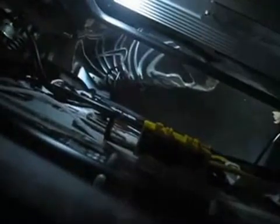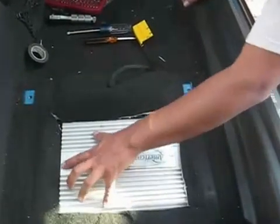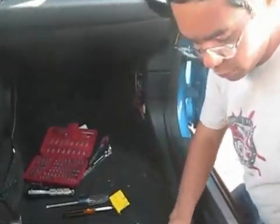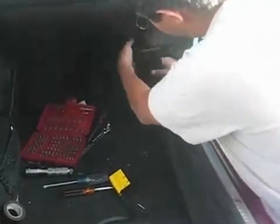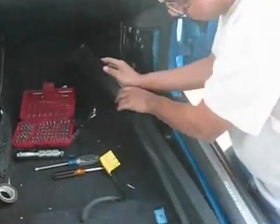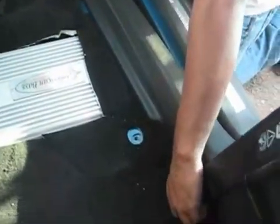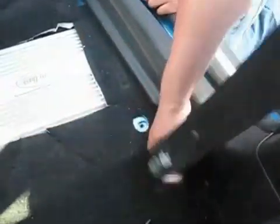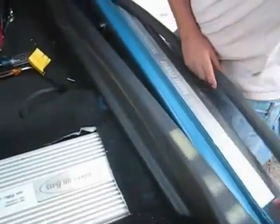Be sure to pull the battery before you unplug the airbag or you'll get an error. Whether you're removing or installing, it's the same process. To get under all of this, put your hand about right here and just start pulling. You also need to remove the seatbelt bolt — I forgot to remove that. After you remove the seatbelt bolt, that's about it. You can also take this off a little bit if you want to be more on the safe side. This plastic piece removed.